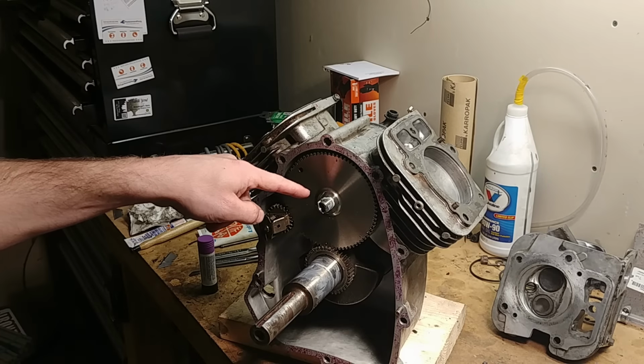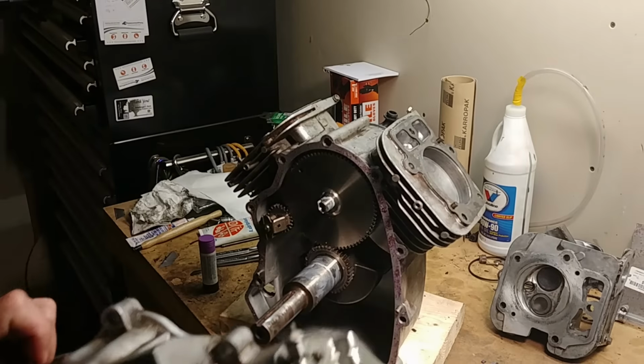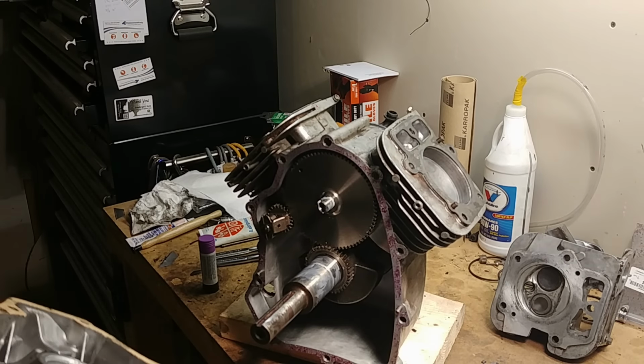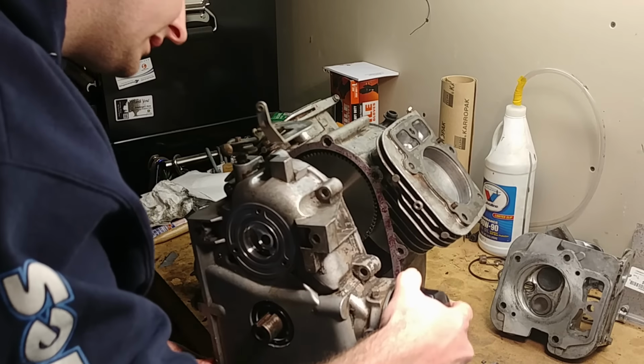I've lubed the inside where the crank goes. I've lubed the crank, lubed the end of the camshaft. The oil pump is removed. You have to remove that, otherwise the slot on your camshaft will not line up. I suppose you might get lucky and it would line up. It'd be incredibly rare. I've never been lucky enough. So slide this on into place.